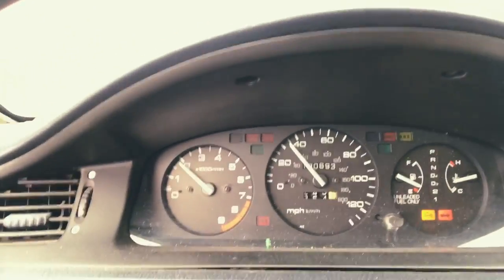All right, so out by that orange grove again, and I'm gonna do 5 to 6 just kind of light stops. So here's one. Keep going. You don't wanna go down and stop to nothing, it says. Working my way back up. 40 miles an hour I'm stopping at. Stop. Keep going. So I'm just gonna keep doing this a couple more times.